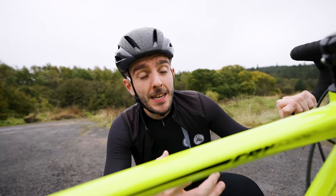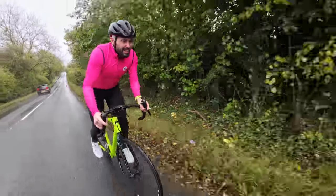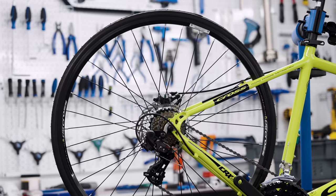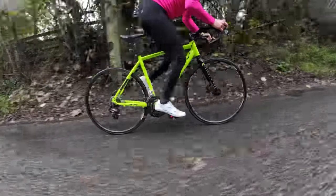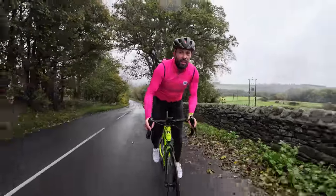Maybe this is a spectre of the triple because it's old stock and they've got it cheap. The problem is if you did want to upgrade it, even the shifters you'd have to upgrade because it's a triple front Microshift. If you were going to buy this bike and ride it around town, get to the shops, maybe commute a short distance, the triple is going to be absolutely fine. It's more when you're out in the hills and need a big range of gears that it becomes difficult. Wheels are aluminium — it's actually a rim brake rim laced to a disc brake hub. Cup and cone bearings, so keep an eye on them. Massively high spoke count, hopefully meaning they'll be strong, but quite heavy. Fitted to them are 23mm tyres, so quite narrow — probably going to feel very harsh compared to the 28mm tyres that have been coming on most of these entry-level bikes.